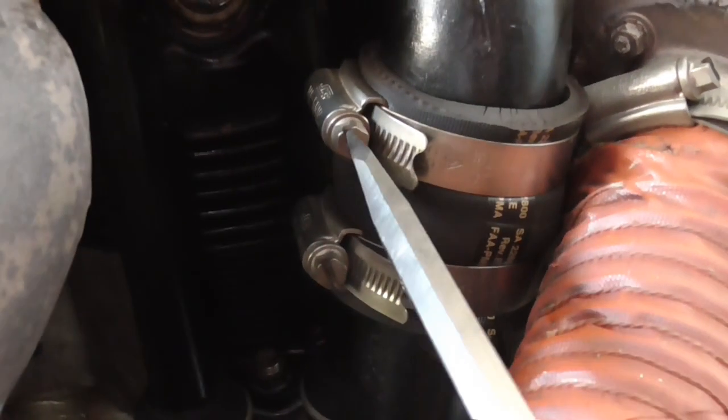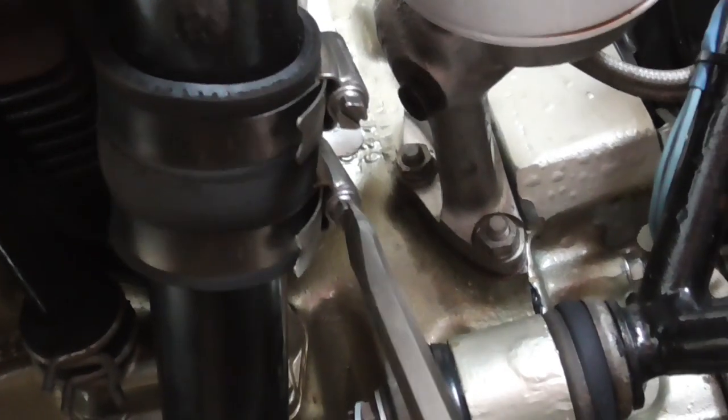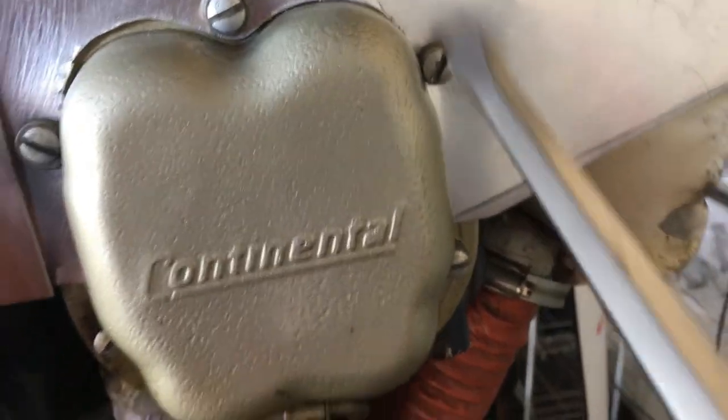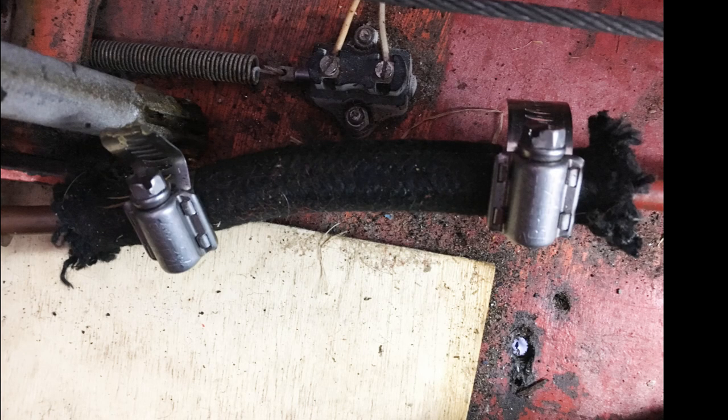That's it. I have filmed a lot of the permit work before, but here are just a few bits and pieces that I don't think I did. We tend to go around and tighten everything up in the engine bay. Then it's an important thing to check the seat bracket, and by removing the tunnel at the back you can access the cables that run through the air brake mechanism and this, which is the flexible fuel joint that needs to be checked.